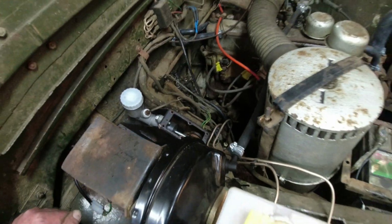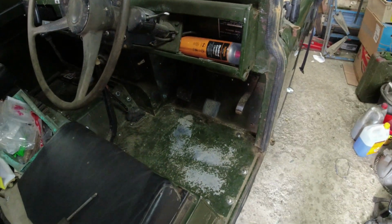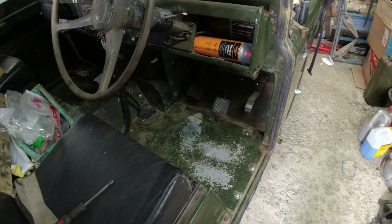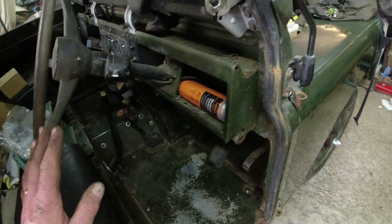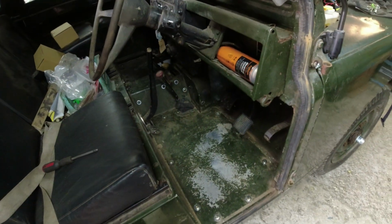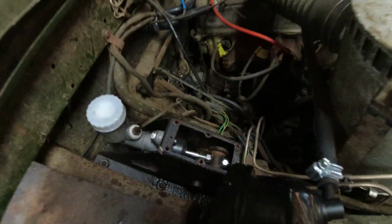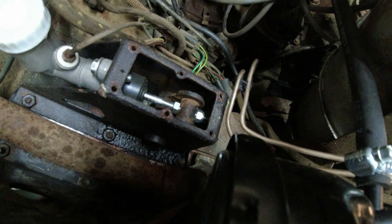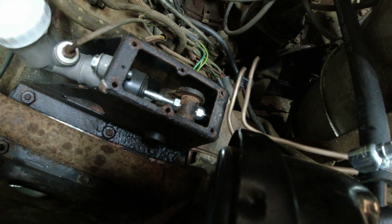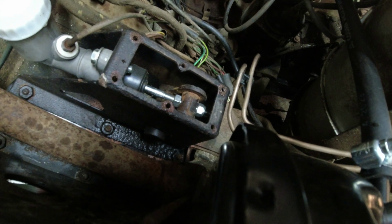Right, hot now, hot day. Looking at the clutch issue here, which means that it crunches in first and reverse, is a very, very slight dragging clutch situation. It's really tight. Now, I've been faffing around, which is why the clutch pedal has been lowered greatly. And the reason I've been faffing around is, look at the pivot. I am going to say that's fooked.